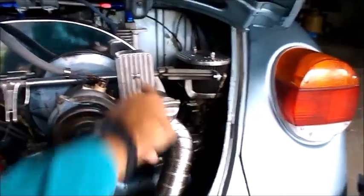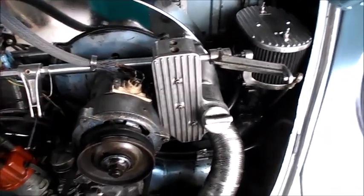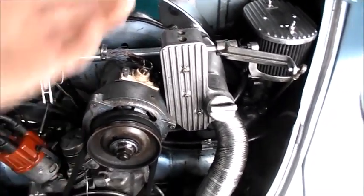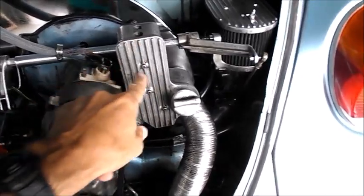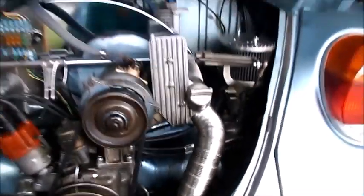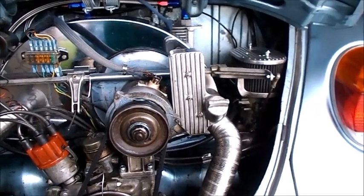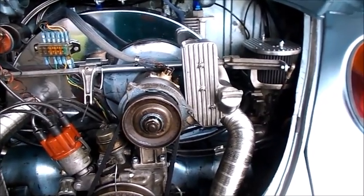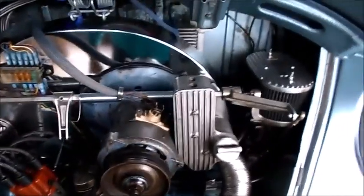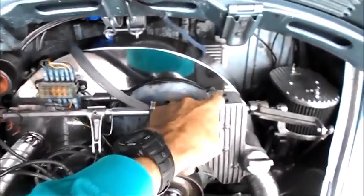The other thing is the breather box. I don't know if anybody's actually noticed this, but notice that all I have is a couple of vacant holes right there. So I'm not actually breathing straight out. What you don't see is that back down in here I have some glass wool. I've had that glass wool in there for decades — I started doing that way back when I was running my 14-15 back in the 80s. For that little dinky engine it worked fine, but I think I have a little too much volume. So, much as I hate to do it, I'm going to drill some holes in the top and build a breather system coming off of this thing right here.